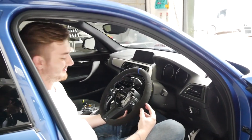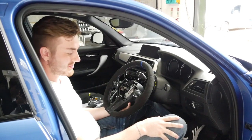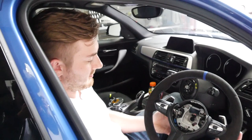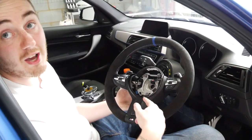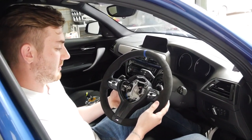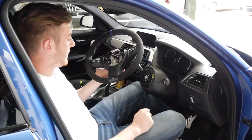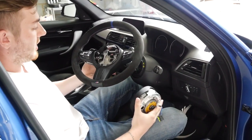The wheel is all done. Josh — who is the owner of the M235i — did the honours of changing the wheel. Look at that — it looked good when it was bare without any buttons, but now it just looks so cool. With the trims and paddles back on, and the carbon fibre piece instead of the silver bit — that's absolutely amazing. The wheel is going back on now, torqued back to factory settings, which is about 60 to 65 Newton metres. The airbag goes on last with the final plug.